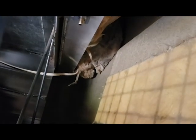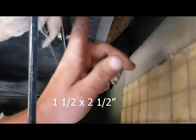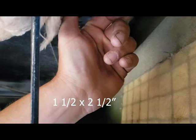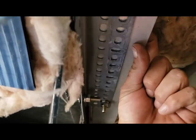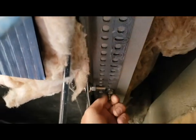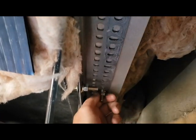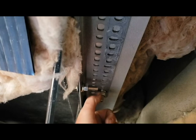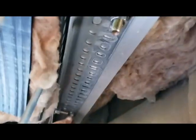So what we did — we came in here with some 1.5x3 angle. We then took and drilled up through this aluminum tubing right here, and we put grade 8 bolts. It's got a bolt coming down with a washer, comes down, another washer, a lock washer, and it's been Loctite red, and then a nut on it. We did that in three places.